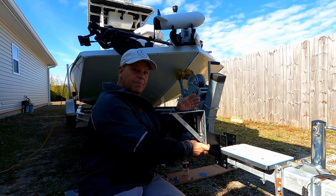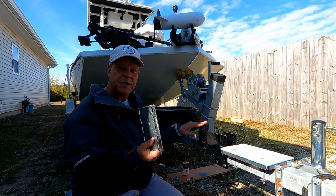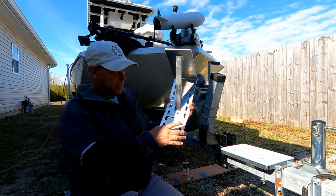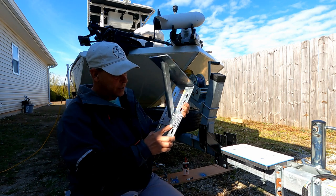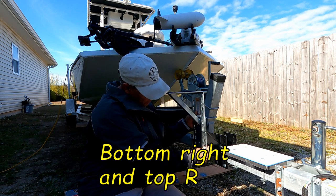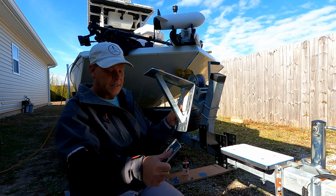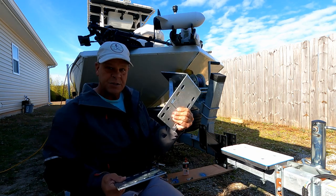After you drill your two holes, mount it at the highest position and about here will give you 10 inches or so of step-up clearance. Now for the extended height install, we are going to use the plate that came with the step. The first thing is to put the plate together — you have the four bottom holes lining up with the four top holes of the plate. You can bolt it together temporarily and put it in position. Bolt this one into place and this one into place because these holes line up, then mark your other two bolt holes. You will drill a hole through this plate and this plate.